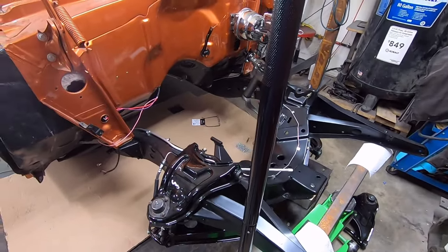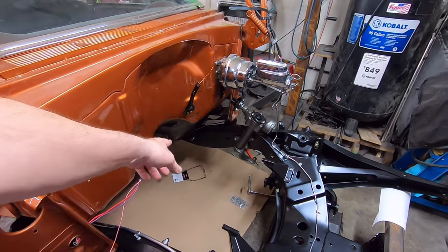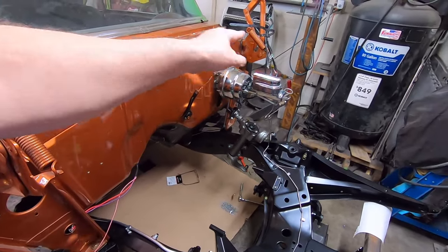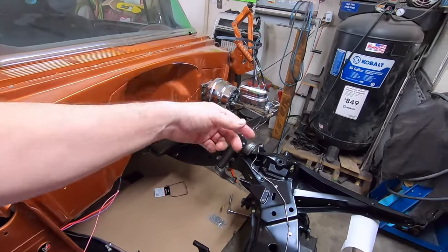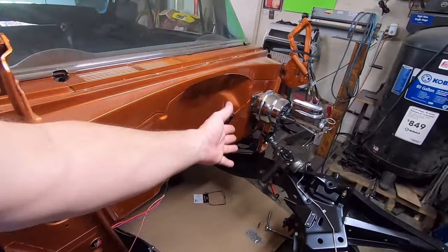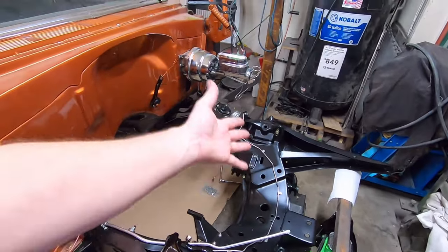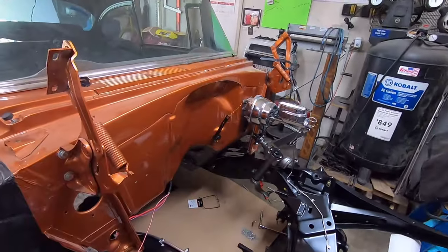What a job — climbing in and out, in and out. I bent up a dummy brake line first out of an old used brake line, straightened it all back out, got in there and bent it the way I needed, then set it in the floor to bend the new one to match. It's always easier to do it out of wire, coat hanger, or welding wire first — build a mock-up dummy line, lay it in the floor, and duplicate it on the new line. That way you avoid screwing up a new brake line. Anyway, doing a steel brake line with a double flare at 45 was easier than worrying about his 37-degree stainless lines, since I don't know if they're annealed and I don't have a lot of experience with stainless.